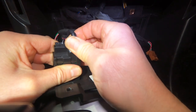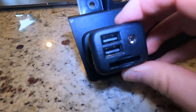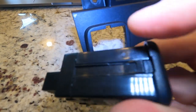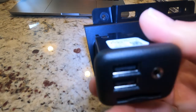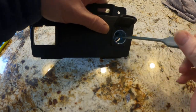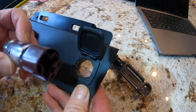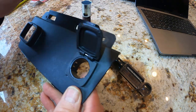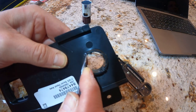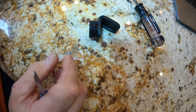Removing the USB plugs was difficult too — I didn't want to break anything, so I really took my time and slowly worked them out. Be very patient. Once you get the plugs out, the piece pops out pretty easily. There are little clips on the side you have to depress to get that piece out without breaking. For the cigarette lighter, I got a tool online supposedly to remove it and it did not work. Finally, after about an hour and a half, I figured out I had to carefully bend the plastic at those two little hinge clips to remove the cigarette lighter and the cover.